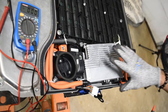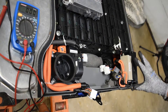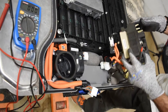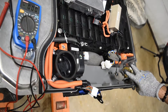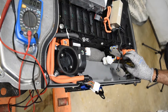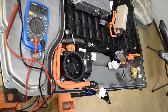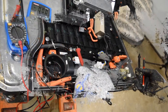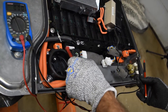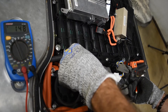In order to get to the battery leads, you have to remove the BCM first. I have done that already. Next is to loosen up the screws for the relay and then push out the relay so the prongs are disconnecting from the leads. These are the two leads that we have to get to in order to charge the battery. You can see there's a top part and a bottom part of the battery. Both parts together get you to 300 to 350 volts. A single pack is about 150 to 175–180 volts. Let's do a quick measurement of the top part — the plus side is on this side, the minus side is on this side — and you can see that we have 148 volts.